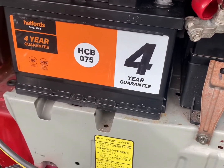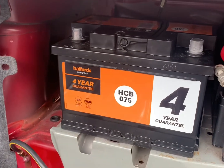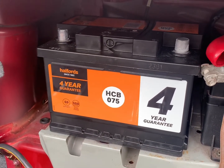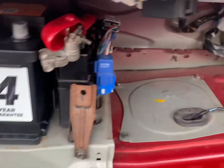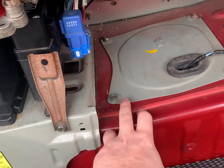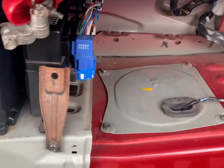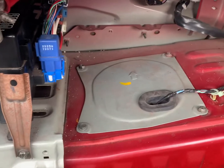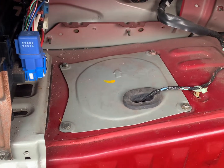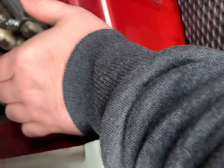I'm going to disconnect the battery because there are wires in the pump and we don't want those connected while we're messing around. Then you've got four bolts on your fuel pump cover — 10 mil — so knock those off. From there the plate lifts up and these two connectors can come undone, which lets you throw the plate to the side.